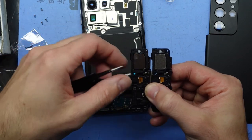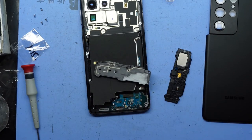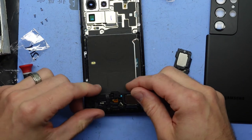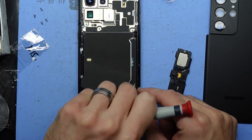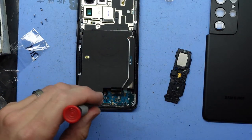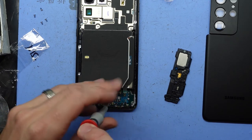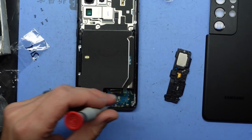I can see a little bead down here but I'm not seeing any beads on the other side — not sure what they actually represent. I'll put a mark on that one and here. It is getting fairly warm, still sitting on the heat pad at 75 degrees Celsius, which is perfectly fine to work on a phone. It shouldn't really cause damage, although on cheaper LCDs it will cause them to separate, so don't leave an LCD too long on the pad unless it's connected to an aluminium body. With an OLED we should be fine — they're tough and can handle it.